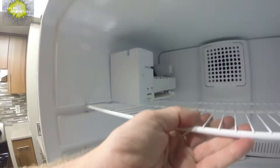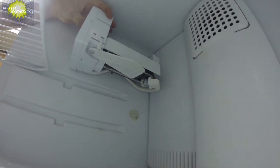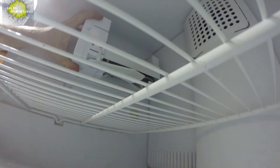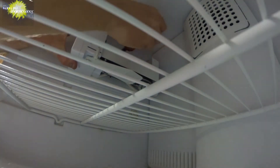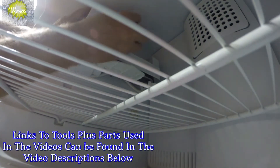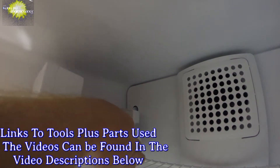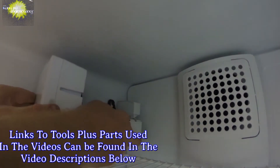On this one the shelf was too high, I just need it lowered to the next spot down. Most of your ice makers will come with the mounting screws. This one the ice maker had been removed prior, so just adding it to the screws that were already there — just loosen them up and slip the ice maker over the screws, positioning the fill tube down into the ice maker itself.